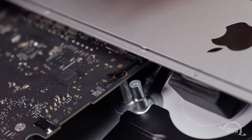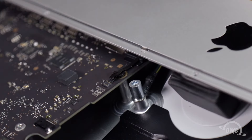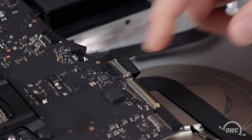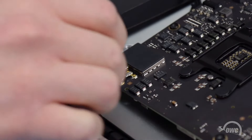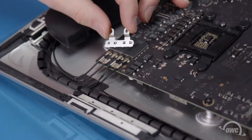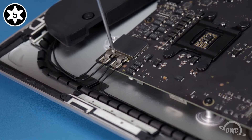Now we can reconnect all the cables to the logic board. For the microphone cable, slide it all the way into its connector, then push down on the latch located on the opposite side of the cable. To reconnect the headphone cable, simply align the two connectors and snap them together. Slide the camera cable into its socket, then use the metal bar to latch it into place. Arrange the Bluetooth and airport antenna cables in order over their connectors, then snap the connectors together by pushing on them straight down. On the long edge of the metal cover, there are four small teeth that align with four small holes in the rectangular piece behind the connectors. Set the cover into place and secure it and the cables using the two Torx T5 screws.